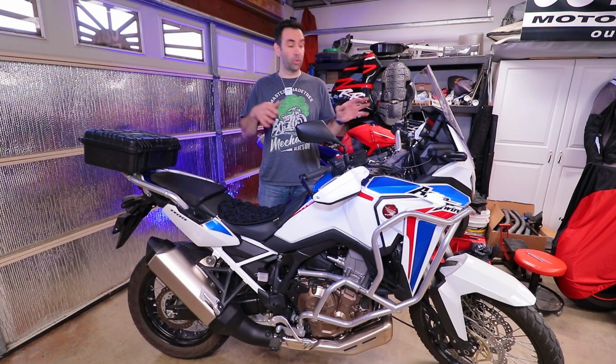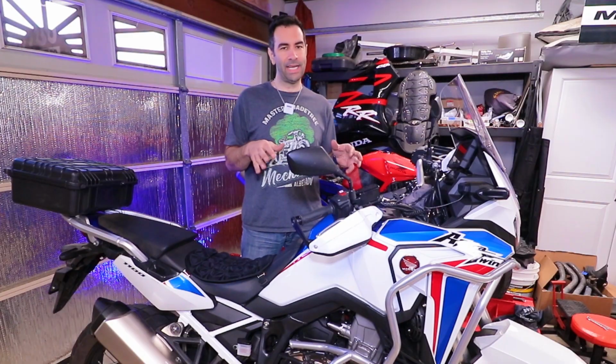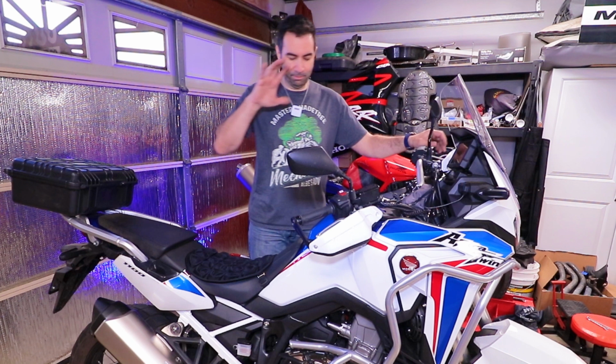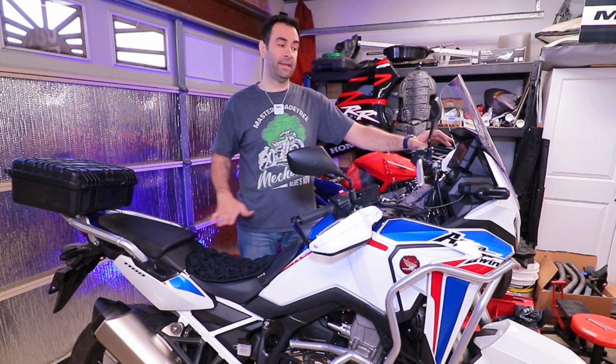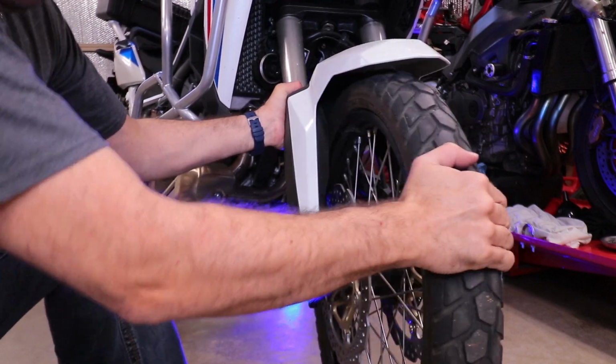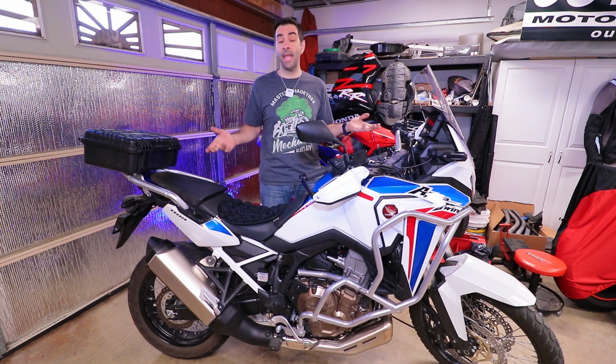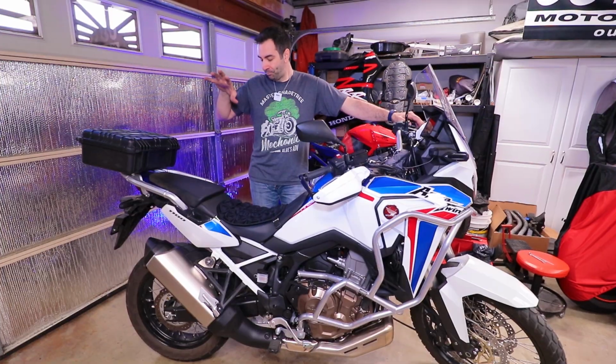One last thing to do to the wheels is to check the bearings. Now, at 4,000 miles, chances are the bearings are good, but put the bike on a stand, then grab the forks and shake side to side the front wheel, do the same with the rear wheel and see if there is any movement. No movement, the bearings are good, and you are done. We are done as well for today.